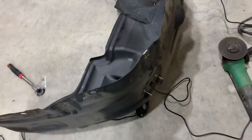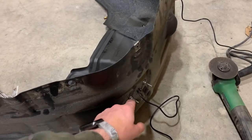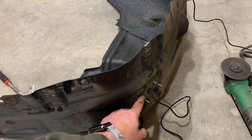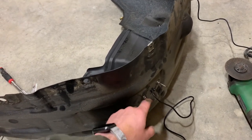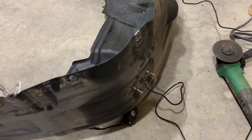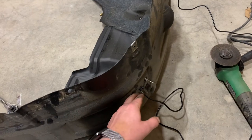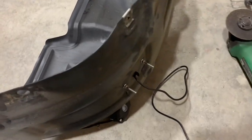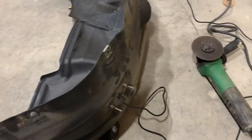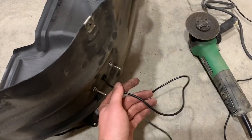Keep in mind that when you tighten these you are tightening into plastic, so you're cinching between plastic pieces. If you feel more comfortable putting a washer here, go ahead. I found it easier to skip the washer and just use Loctite — that way I can get it snug without worrying about it getting loose. I'm going to trim these studs; it's easier to trim them once they're on using an angle grinder. Just be careful not to cut your wire.